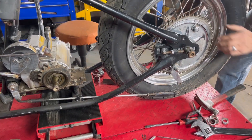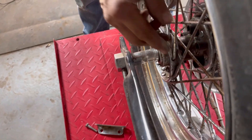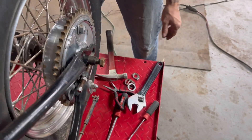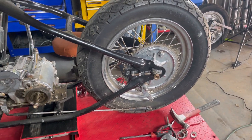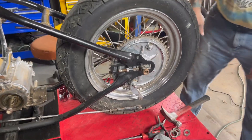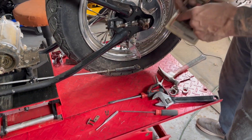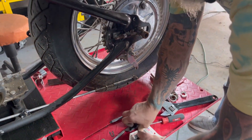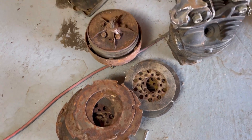I need to take these five bolts off inside here. Basically what I'm doing is taking the drum and the wheel and separating them - pull the wheel out, then pull the drum off. I do have to get inside there and I'm hoping I can find the stuff to do that because it's a tough process. It's a 7/16th. When I was looking through parts I actually had a brand new set of Colony bolts - that's what these are - the five bolts that hold the drum to the star wheel hub. Both the star hub and mid-star use the same, and that is a 7/16th.